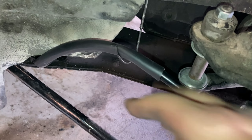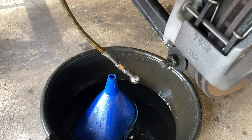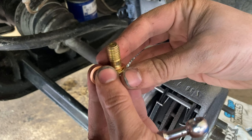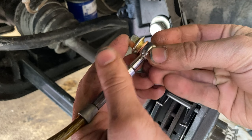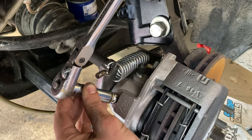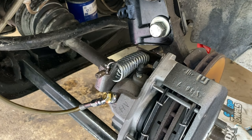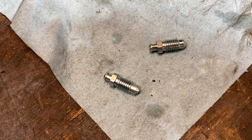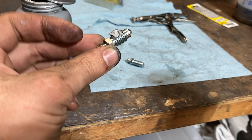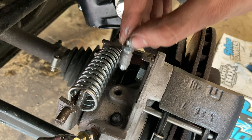To get this old fluid out, I'm going to reinstall the cap on the brake master cylinder and then depress the brake pedal until I have absolutely no pressure at all. Make sure you put copper washers between the banjo bolt and the brake hose, and then between the brake hose and the caliper. Tighten the brake hose banjo bolt to 33 foot-pounds — I might do a little bit less just because this is aluminum. Let the copper washers do the work. Before we get started bleeding the brakes, I'm opting to replace all of my brake bleeders. I'm going to coat the threads with some anti-seize too so that they don't get stuck. Do not coat the tip of the brake bleeder with anti-seize — only the first couple of threads.